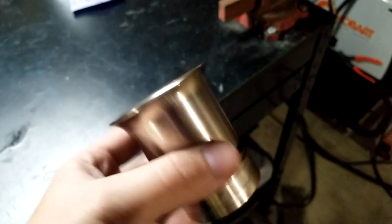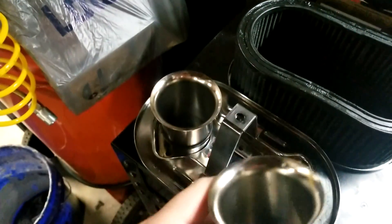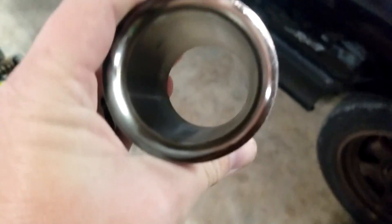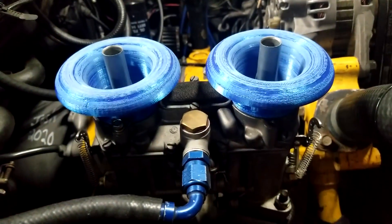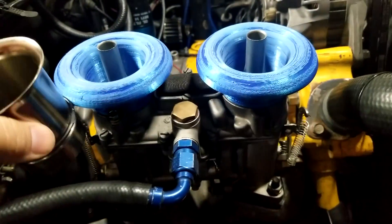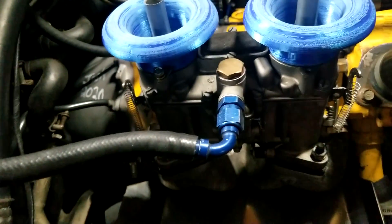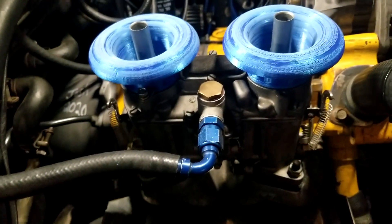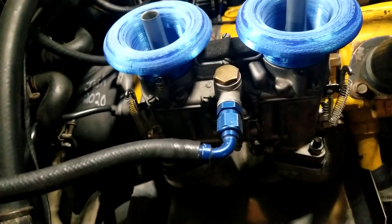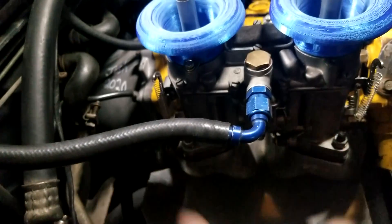Here's the factory air horn that came on the Weber — there's both of them. If you follow me on Instagram or Facebook, you'll know I've been 3D modeling these. I finally finished two test ones — here they are. They're shorter, obviously much shorter than the Weber ones, and that has to do with airflow. Shorter runners make more horsepower at the top end. This motor makes plenty of torque.